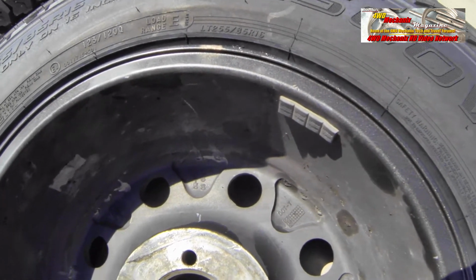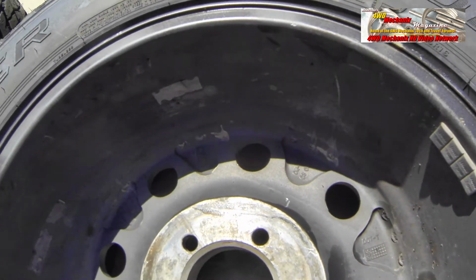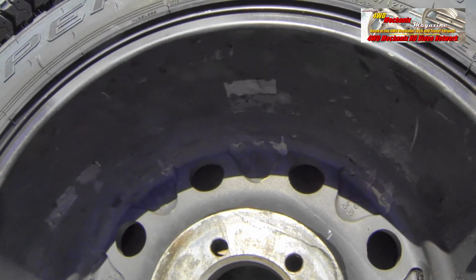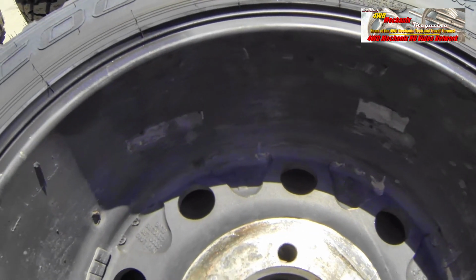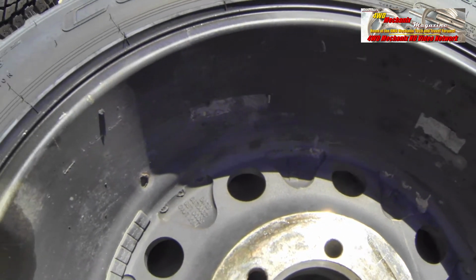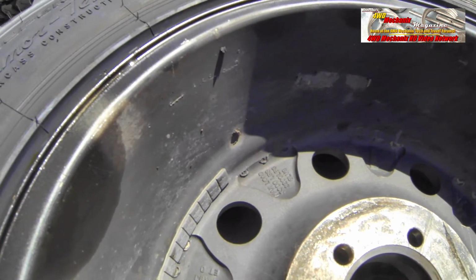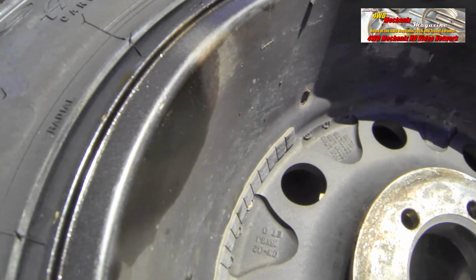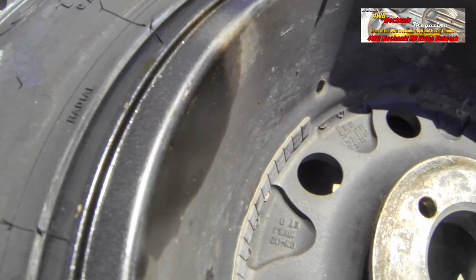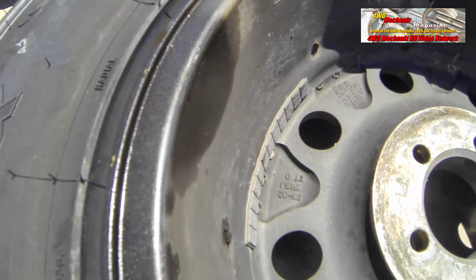That the wider the wheels and tires get, the more likely dynamic balancing will work better. Dynamic balancing counteracts rotational forces both on a vertical plane and a lateral plane. Vertical or static imbalance on a wheel that's rotating will cause the wheel to spin elliptically. This is due to the imbalance weight that is wanting to fly away from its center. This causes the wheel to bounce up and down. In turn, this can create vibration and rumbling sounds within the truck or 4x4.